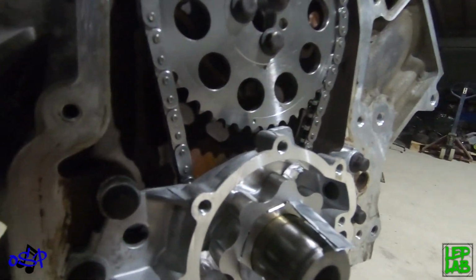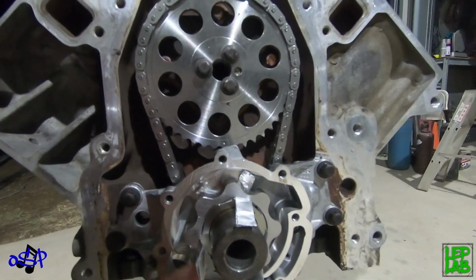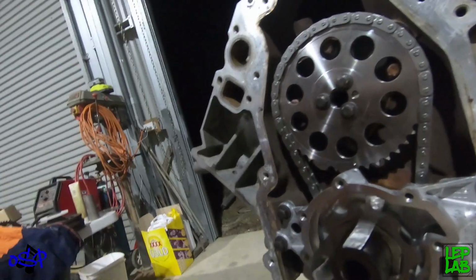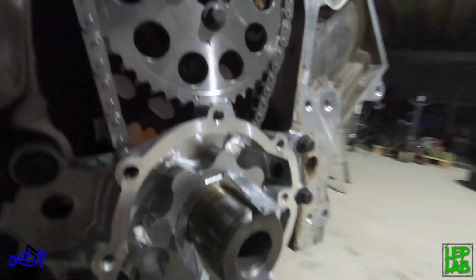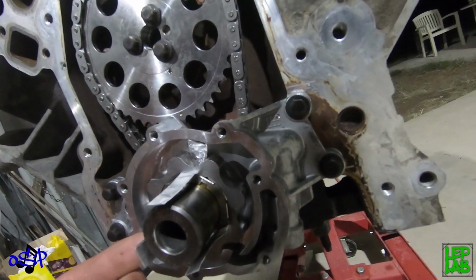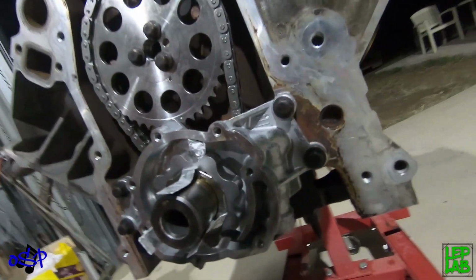put the housing on, and you put that center gear over the collar, and generally you'd use a proper shim, 2 to 3 thou shims. Unfortunately, we don't have any, and I don't have enough feeler gauges to use them either. So, as we usually do, we've had to come up with our own solution, and believe it or not, I've folded up some alfoil, and that's our 3 thou shims folded over a few times.